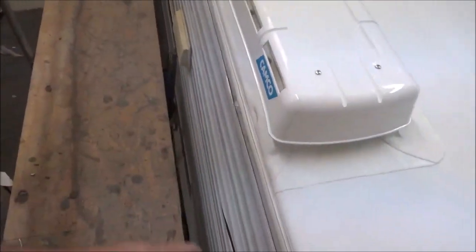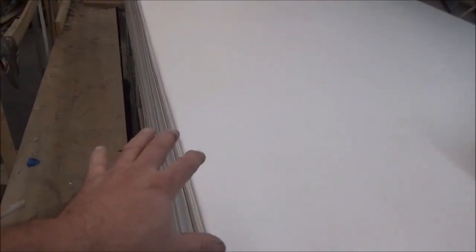And again, we do the refrigerators the same way. It's got the same flashing detail on there. And we put 2 strikes of caulking down on here. If you've ever operated a caulking gun, when you start squeezing the tube, you'll hear it crackle and pop a little bit. And what happens is you're burying an air pocket up underneath there. So as the coach is going down the road, racking and twisting and flexing, that little air bubble could pop. And if it does, you've got a potential leak. So the best way to eliminate that is to put 2 layers on there. And that's what we do. We wait for the first one to cure out, and then we go over it with a second layer.